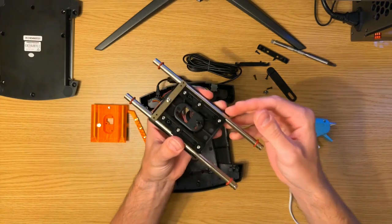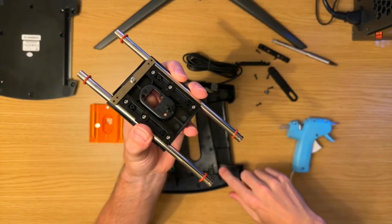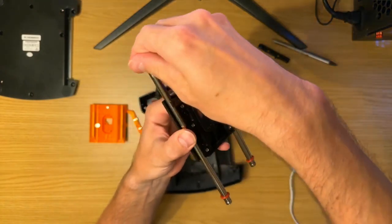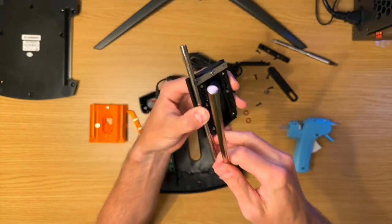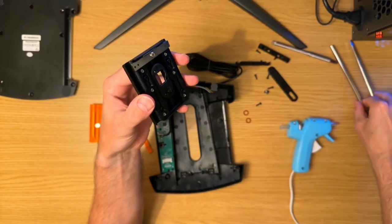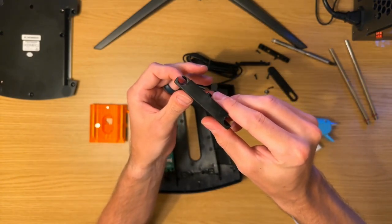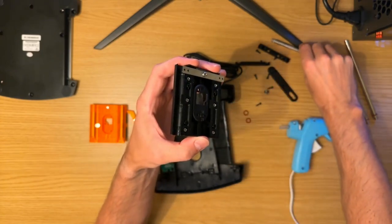This is the stock system right here. You'll see similar material to what this case is made out of just rubbing on these rails, and this is brand new. You already saw the performance brand new — you can imagine how quickly the material can wear down if it continues to operate that way. In wearing down, it actually makes the stiction worse, and it expands the races here that the rails rub on, so it increases mechanical play or rattle. It just degrades in every way you wouldn't want it to.